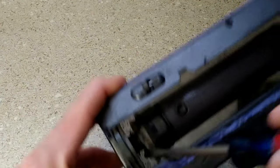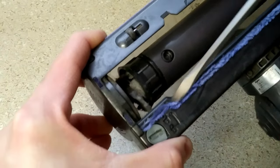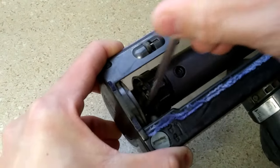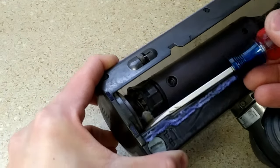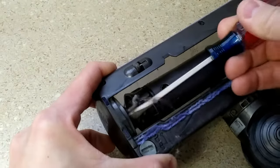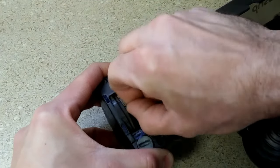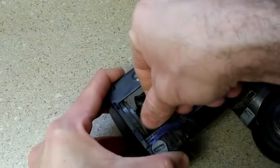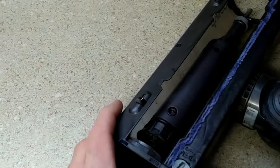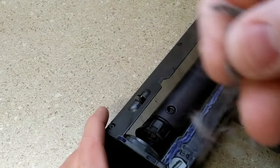As you can see down here — get a little closer — here's your spring. You can actually see the buildup here, look at the debris. If you're using this every day like I do you're going to get debris in there. When I use this it's for — see the hair, look at the hair that's built up on that. In a commercial building you don't know whose hair this is, but always just wash your hands when you're done, because hair can cause a failure after a long time as well.